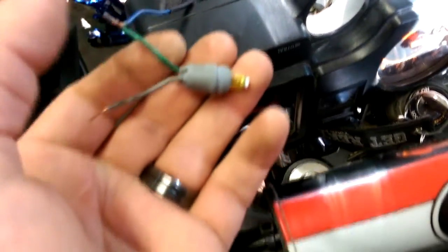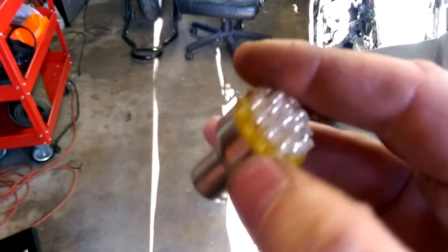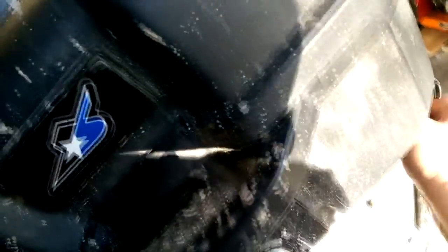I was frustrated there wasn't an exact guide out there — that's why I had to have a guy call me. I hate reading forum posts, replying, and waiting. When I'm doing something I want to find a video that explains it. A lot of things on my channel are guides for things without many video guides. For the turn signals, you replace the dash bulb with a 74 and get four LED turn signals. The external bulb is a 100-degree angle LED, I think it's an 1156, with 19 LEDs on it.